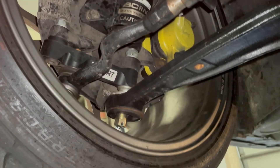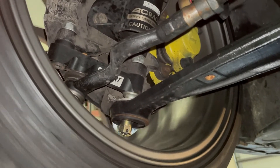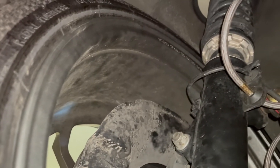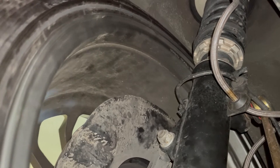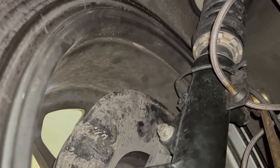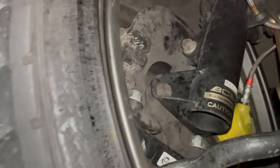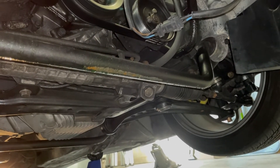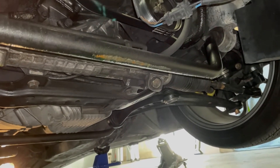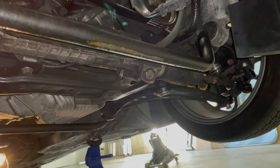While I was down here I found out — yeah, all that noise, like rubbing — that's up here: the strut is actually touching the wheel. So I ordered a three millimeter spacer for both the fronts because my fitment is almost perfect right now. I just want to get it to where it clears the struts.